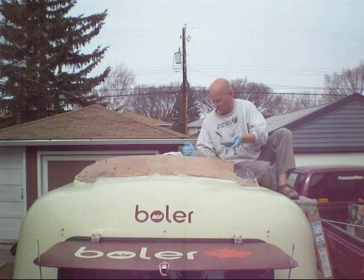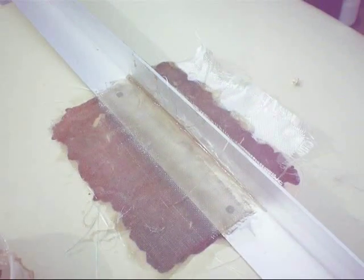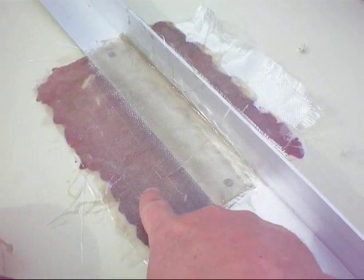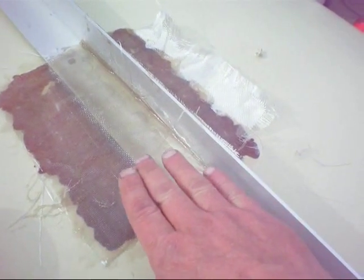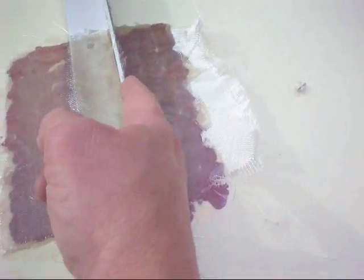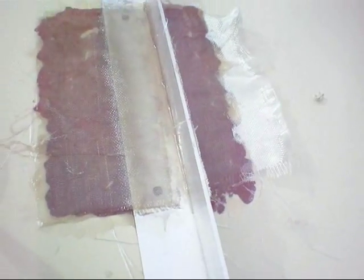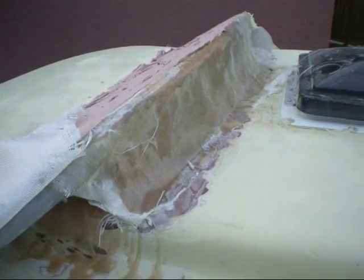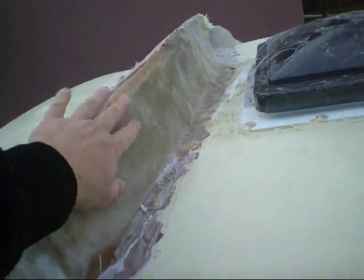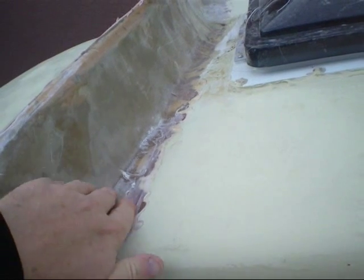Now I'm going to work on my solar panel holders in the back here. What I've done for my extruded aluminum that holds my solar panel is I've taken them off — I've ground down this square patch right to fiberglass. I've got two layers of fiberglass on the bottom, everything's soaked, and then fiberglass flipping around here to attach, and same thing coming up here to attach. Once that dries I can smooth it out with Bondo and paint it. Here's the progress so far — I've put a double skin of fiber cloth there. It's fairly stiff, rolling a bit but I'll just fill it in with Bondo after.